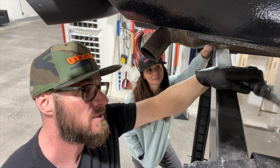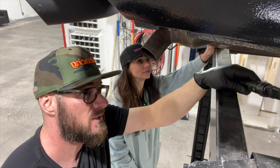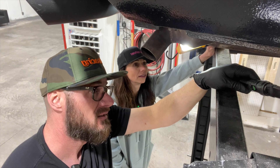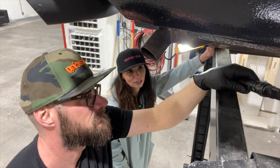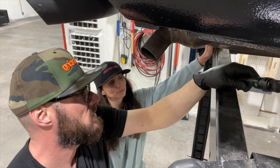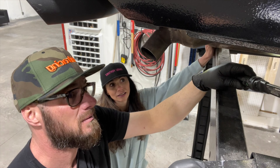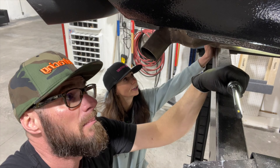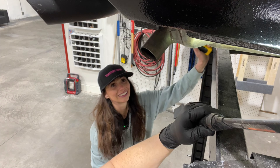This is the hokiest exhaust I've ever seen — that's like my welding skill right there. I'm not seeing a bunch of body rust from the inside, which is nice. There's more oil — yeah, is that oil? This one in the center — that is probably engine-out to fix, because these cars have two halves and you can't fix this seal here without the engine coming out.